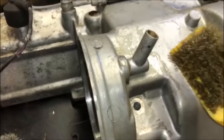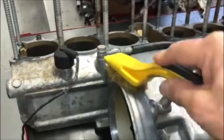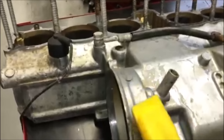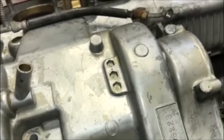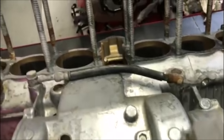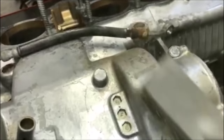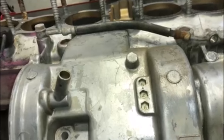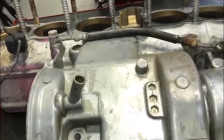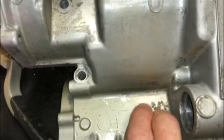If you have the cases split, it's worth it to check the oil pump. Back to the cases — to get the stains off you just take a wire brush. It's a tedious process, but before you repaint it's good to clean it up completely so your paint job turns out a lot better. On my next video I'll show you how I do that. I'm probably going to put paint stripper on this to get the factory paint off and get it back down to raw aluminum — the whole engine will look brand new once it's repainted.